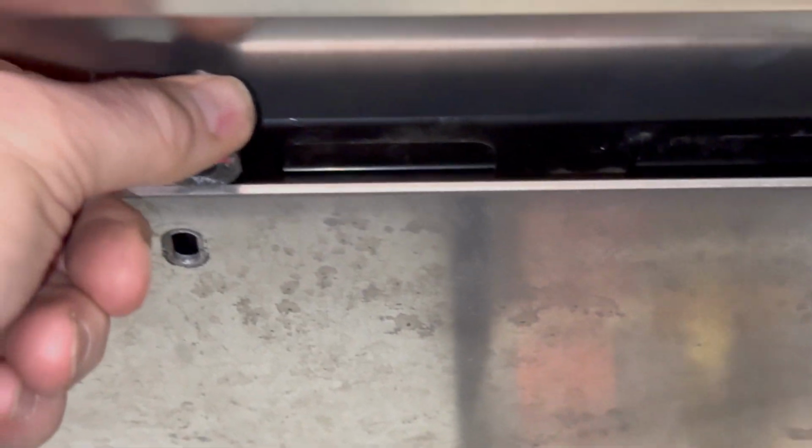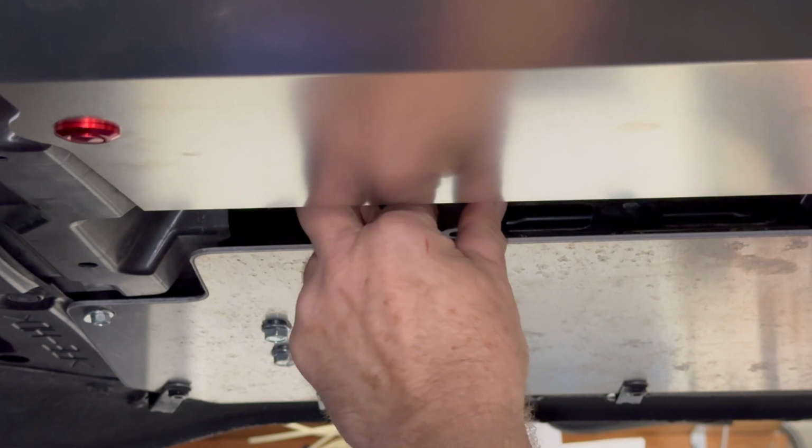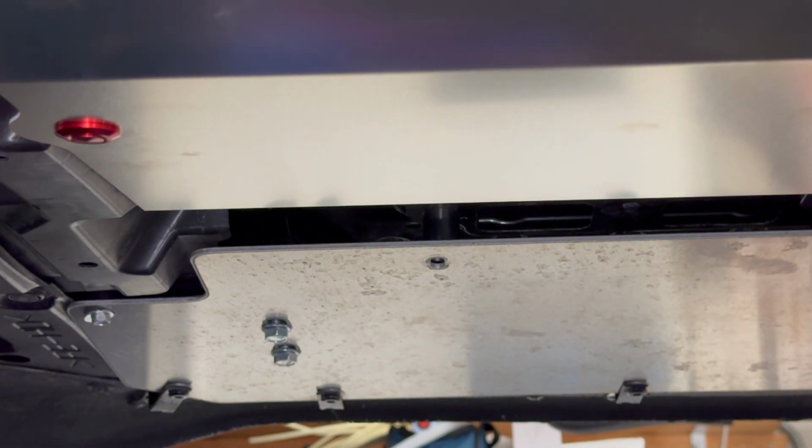And now I just have to do the 10mm bolts up front here. And this one is curved. The RACER X one is curved. Go up in there. The Artwork Body Shop front one, because it's not, they provide these spacers. So you just put those through there, just like that. And once again, there's place for airflow. So if you're running the front OEM one, at this point you'll just use those bolts. I have longer ones for this that came with this piece.